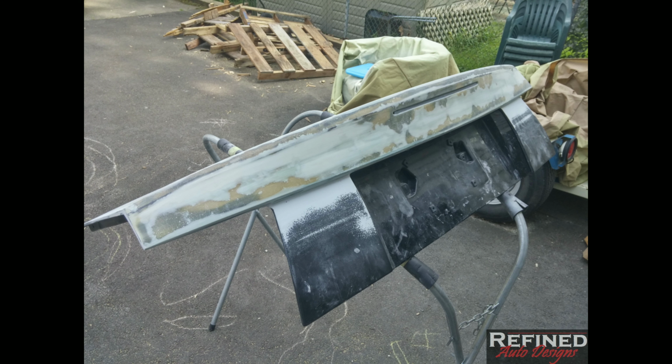I have a little LED strip, which you can actually see there in the center. I just took a cutoff wheel and marked where I was going to put it, and I cut down slightly into the fiberglass, and when I did my body work on it, my layers of filler, I just worked out, and I didn't put any filler in that area where the third brake light's going to go. And I just built it up.